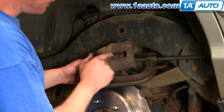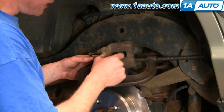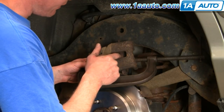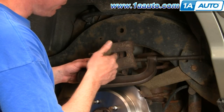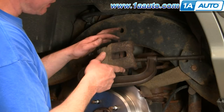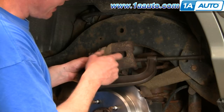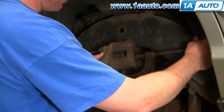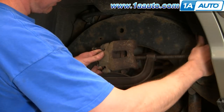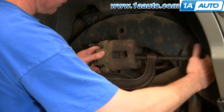The adjusting mechanism in these brakes is the caliper itself. This is the piston. As the brakes wear down, the piston just kind of edges its way out of the caliper. To put the new brake pads on, you need to force that back in. I've put my old inside pad back into the caliper. Now I have a big C-clamp here and I'll just slowly tighten up the C-clamp and you'll see the piston go back in.